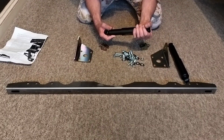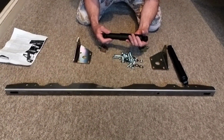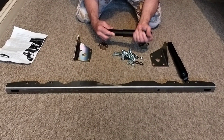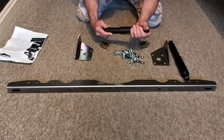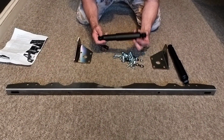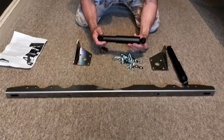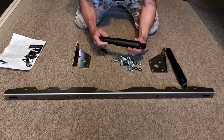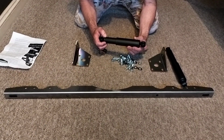Well, the oil damper is quite a smooth road style, normal driving, replaces your lever arm damper and damping. As you can see, I'm just about moving it up and down. But when these get older and you drive a lot, the oil in here thins and fades, so you get less damping quality. With gas, you don't get the fade, so there's much more improved ride at the rear.